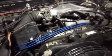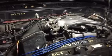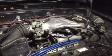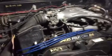There's really not a whole lot to it — it's one of those things where if you've ever taken a motor out of a vehicle, it's pretty much like that. On hood clearance: some guys have to run a hood scoop or cut a hole in the hood. I didn't have to do any of that — I'm running inch-and-a-half ball joint spacers up front, and I didn't have to clearance my hood at all.